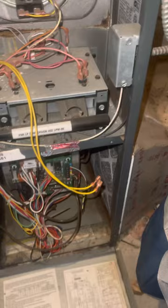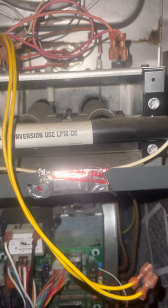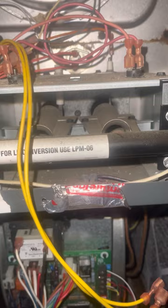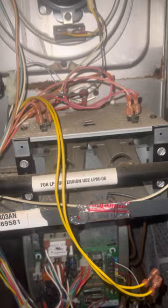To test, you turn the power on and what's going to happen is — where these burners are — that element you see inside with the white ceramic on it is going to turn orange and glow hot. Then after about 30 seconds the gas will start to be delivered and you'll see the furnace ignite.